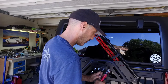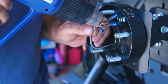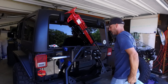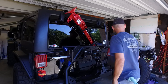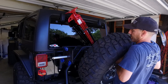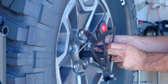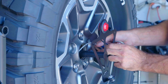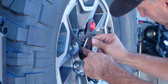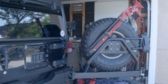Attach the female barrel connectors to the ends — I tend to get carried away and like to add some heat shrink to these. Then make a quick splice in the wires for the center brake and license plate lights on the mount itself. Now you're ready to put it all together: heave that spare tire back into place and bolt it down, then put the license plate bracket in its mount and plug each connector into the proper wire from the harness. I did find one more glitch — having to run a wheel spacer with the stock rim meant the quick-release pin for the plate mount wouldn't fit, so I used a quarter-twenty bolt and nut for now. And that's it for the install portion.